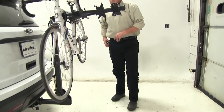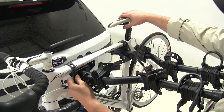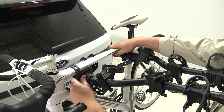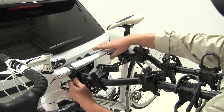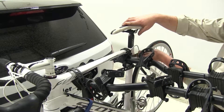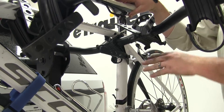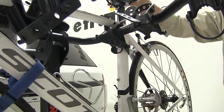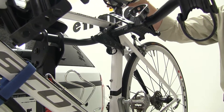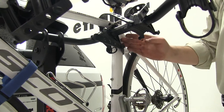From there we'll move up top and talk about the straps. You have your cradles up here on top, and these two straps are going to be your frame cradle straps, which are going to help to keep the bike down and on the platform and to keep it from bouncing up and down. Next we'll talk about the strap on the side, which is going to be that lower hanging anti-sway strap. This is going to keep your bike from swaying from front to back while you're driving down the road. It's also going to be the first strap that you need to put on when you place your bike on, because it will keep the front seat post all the way up against the cradle.